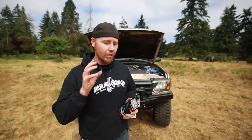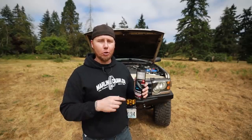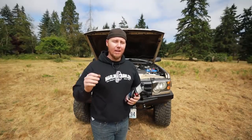And today specifically, I want to talk about dilution, because this is something a lot of people don't think about. I see people ask questions online, like in Facebook groups and whatnot, like if you use too much of an additive, can it hurt your engine or hurt your fuel system or anything like that? And the short answer is no. You could theoretically, if you have such a high detergent and your system is so dirty, maybe plug a filter or something like that. But the main issue you could run into if you use too much of a product would be dilution. The root word is dilute. If you dilute your fuel system too much, it's going to make it to where a product like this isn't giving you a negative effect in your engine's performance. However, the lowered octane rating of your fuel, because it's being diluted, will impact your engine's performance. So I hope that makes sense.